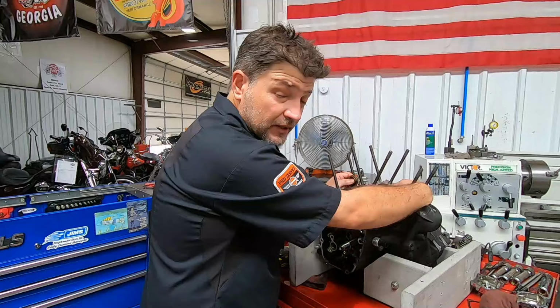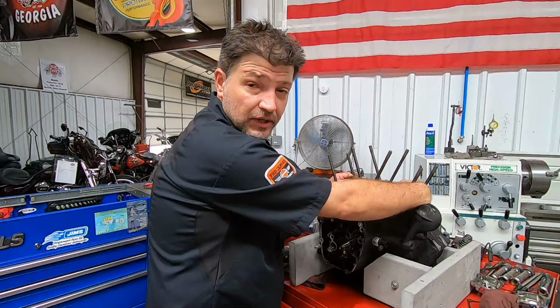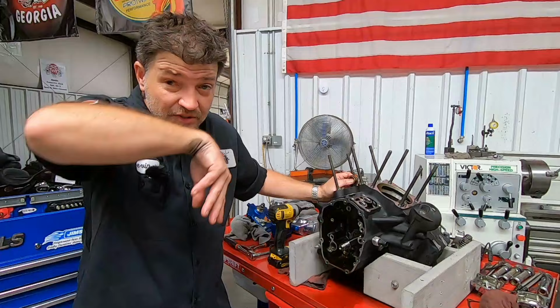Well, that's it, guys. I think we've figured out where the noise more than likely is. It's an interesting thing, of course. Sometimes we do get surprised. Six and a half thousandths runout. No, that's not ideal, but at the same time, it's not absolutely horrendous either. Not enough really to generate a loud knocking noise.